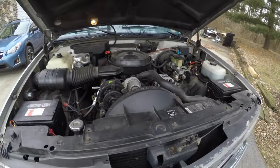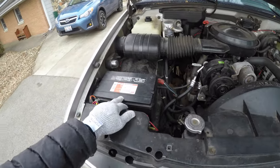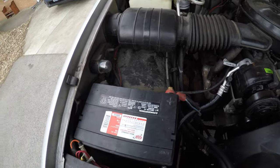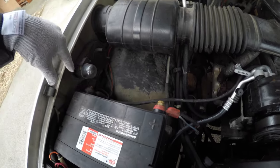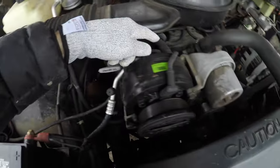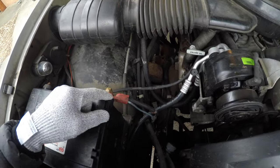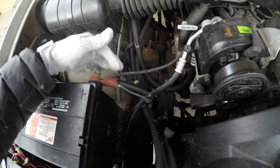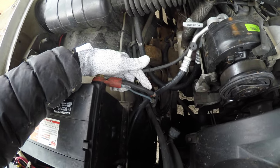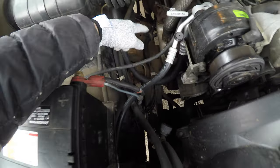I'm going to walk you through exactly how I've got my two batteries wired up. This is my main battery right here. Basically, this is my ground — it goes to the body and to the block. That's my black wire. Then I've got my red wire here, and you'll notice I've got a splitter on here with two wires. This is the customary feed that services everything, and the second wire trails along with it.